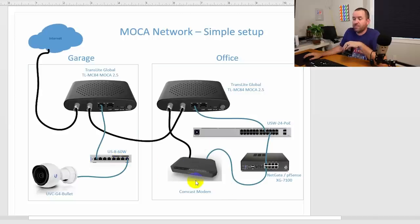If you look at the back of the MoCA adapter, you've got two coaxial plugs. One says in-out. When you're connecting coax together, no matter how many different locations you have, they're essentially one big network — much like plugging a bunch of Ethernet cables into a switch. The in-out basically means in from your service provider, or out to a cable modem or to a TV if you're using cable TV. The out can go to Comcast's equipment — in this case the Comcast modem, but it could also be a set-top DVR box for cable TV.